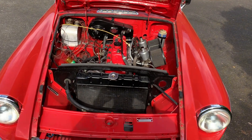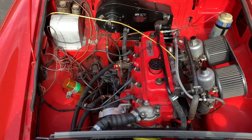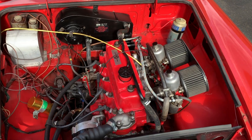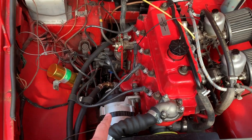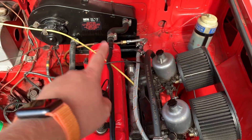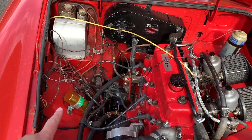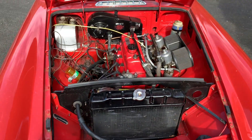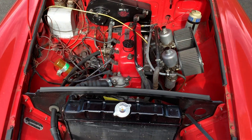Next up, the drivetrain. With the bonnet open: this is an 1800cc B-series engine — hence it's called the MGB. It has twin SU carburettors and points ignition. There's an alternator, water pump at the front, thermostat, fuel lines, and the fuel pump is down by the tank. You have master cylinders for clutch and brake, a heater, coil, and radiator at the front, and an oil cooler down here. All actually very simple and easy to maintain.